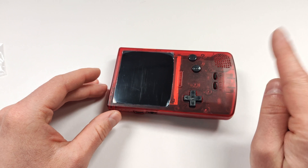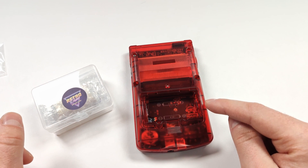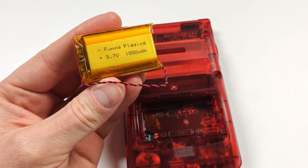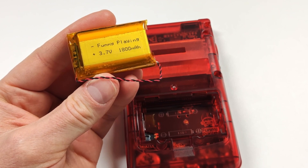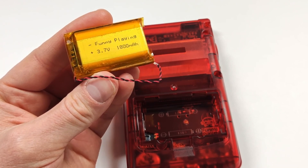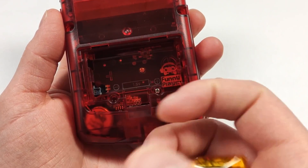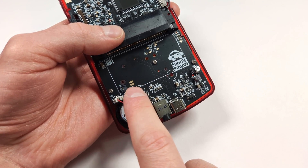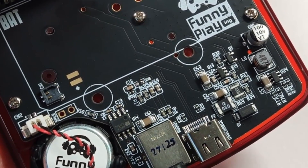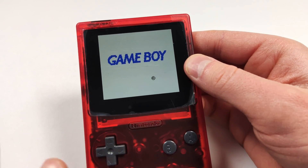Now that we've got that in, let's get the battery in and check out the screen. To get the screen into position, all you have to do is slide it down. Now let's flip it over and get the battery installed. I did notice from other reviewers that the battery terminals were pre-installed, but I don't have any on my unit. This comes with an 1800mAh 3.7V battery, and this should last about 4 hours with full brightness, giving results very similar to a fully modded Game Boy. You want to make sure that the PCB on the battery is on the right side, with the battery cable running along the bottom and the terminal to plug it in right here. After trying for a good while to get that battery connector slotted in, I pulled off the back — I could not get that in. I think the reason is because my battery connector has a small piece of plastic that sticks out in the center part. Finally got that connected.